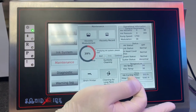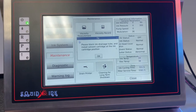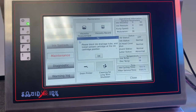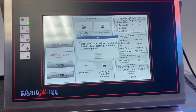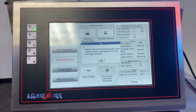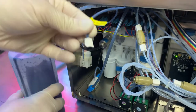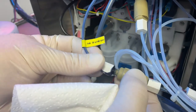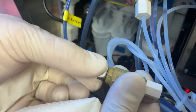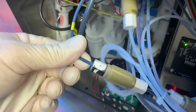Now all we have to do is click continue. The printer is asking us to reconnect the drainage tube — it says 'block ink drainage tube,' which means reconnect it. Go to the back of the machine. You'll see I have a paper towel here just in case there's a little bit of excess fluid. All we need to do is thread this compression fitting back on with the tube in. It can just be hand tight. Give that pipe a little tug to make sure it doesn't slide right out. That's all we need to do to reconnect that line.